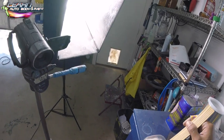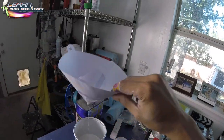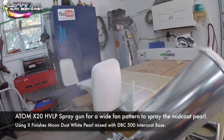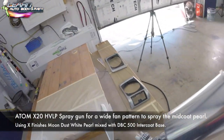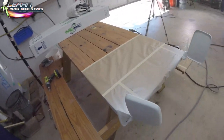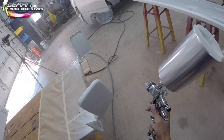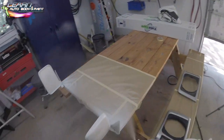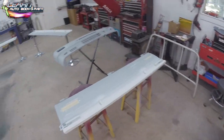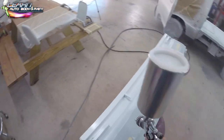You can lay your base coat — this clear base coat as your mid coat — and not have to worry about running it, because you can spray a few light coats to achieve your pearl effect. We're using the Atom X20 high-volume low-pressure spray gun. I'm just coating our white base mirrors here with some pearl very quickly. We're going to give everything two coats of pearl, including the top portion of the cab, then spray our silver base coat on the bottom portion and mask everything up for our centerpiece teal color. The top section of the bed is also going to be white, so I'm just hitting this with some quick pearl effect.